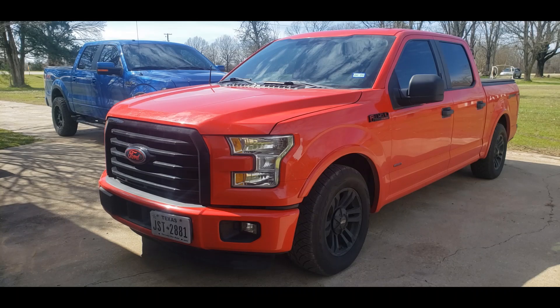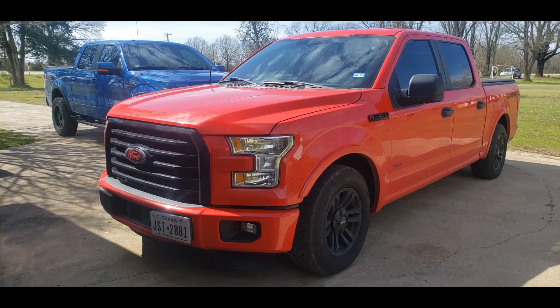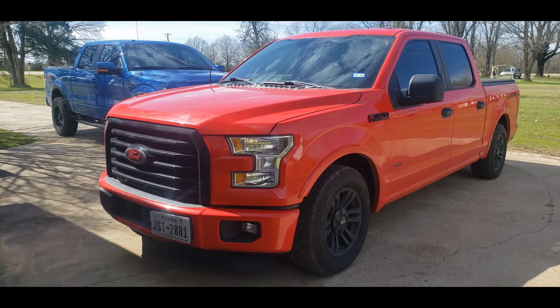This is Red EcoBeast from YouTube. My truck's been highly modified — well, to a point. The problem I've been trying to figure out is I have a slight stumble and a loss of fuel mileage of anywhere from 2 to 2.5 miles per gallon. I thought it was everything from the coil unplug to possible problems with my transmission. Doing a little research, I found out it's the VVT solenoids — the variable valve timing control solenoids.